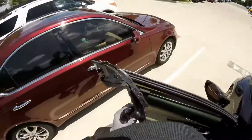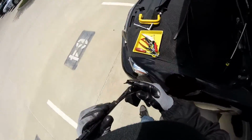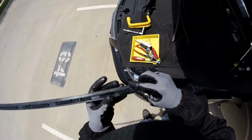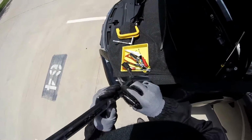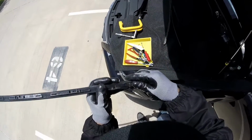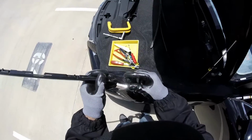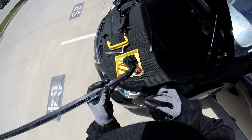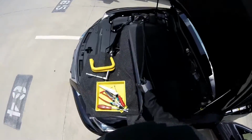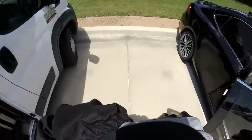You see? This happens on these kinds of moldings when they're older. This part right here, the rubber, just separates because it's welded by plastic and they come up. And this one, you see, they clip back again, but it's gonna come up. You're gonna hit it, you see the click? And it's in place, but it's gonna come up anyway. So what I do is put some spots of urethane with primer, and that's it. And that click is gonna help. And I think this is the same problem, but let me find out.